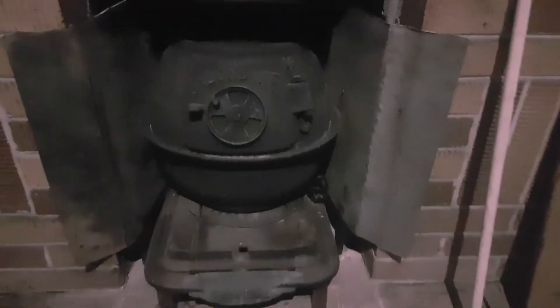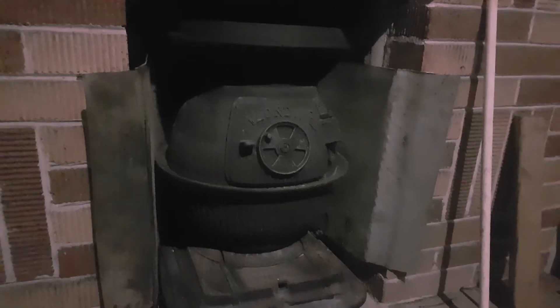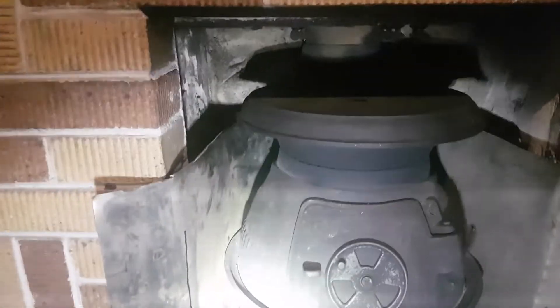There's our stainless steel heat reflector — it's made up of two parts, each side has got 200mm legs that have been welded on. We've got our plates in up there too. I haven't even bothered cleaning the slag off the welds — it's so difficult to get up there, there's just no room. But they're tied into the back there now and that covers up our hole, so hopefully that'll have solved our problem.